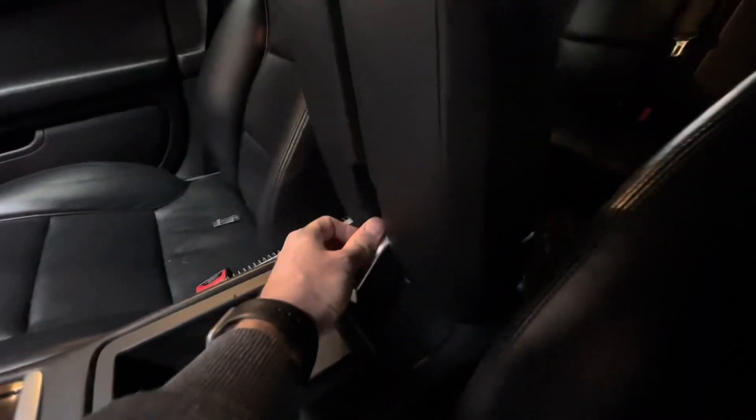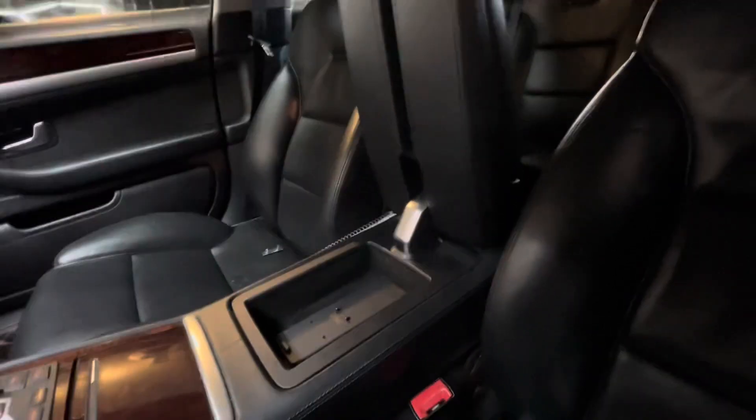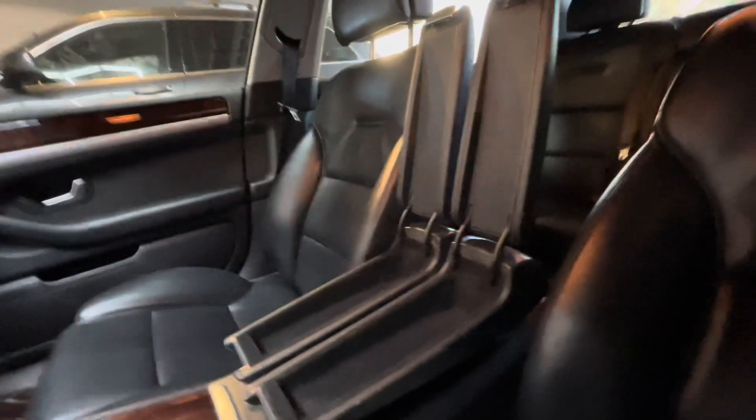I got the console back in. The hardest part was those two Torx bolts — you basically have to put the bottom one in, tighten it, and then push back on this to get the top hole, because if you try to get both to line up at the same time it will not go in. My advice: put the bottom one in and use the armrest itself to pull it back into place. I've got the ignition on and looks like we now have both lights in there, coming on and off with the ignition. Hope that at least helps somebody get the armrest out of there. Anyway, another project finished — thanks for watching.